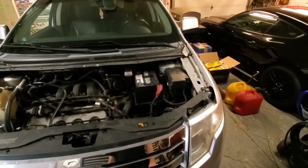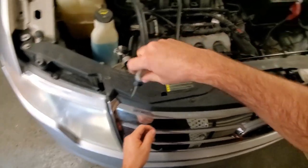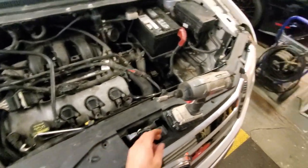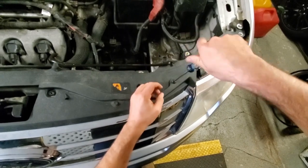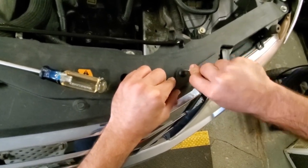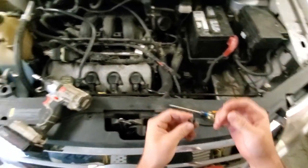The 10mm is missing — of course it is. When removing the push pins, a lot of times they don't cooperate. If they don't work, you pretty much just have to get in here with a screwdriver and pop it up, because if you don't take the centerpiece out first, it'll just expand out and you'll end up breaking the whole clip.